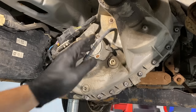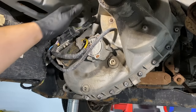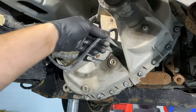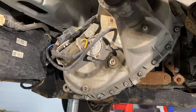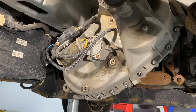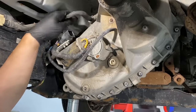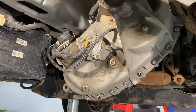The first thing you need to do is identify what kind of circuit you have coming to the main bulkhead connector going out to the body harness — that's part of the shift motor harness. On the newer vehicles you just have a synchronization clutch right here with a single wire that goes over. We need to transfer this wire to our new motor. Go ahead and push down on the black release and pull this connector off, up and out of the way.